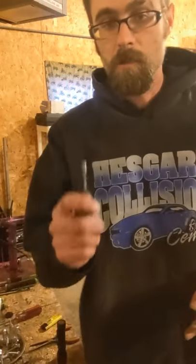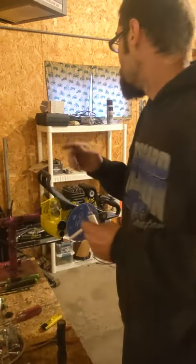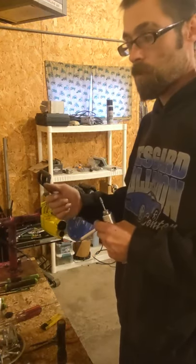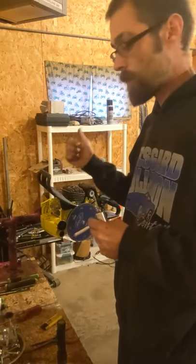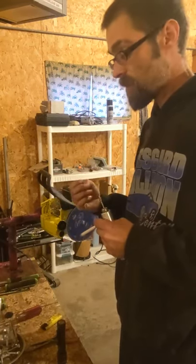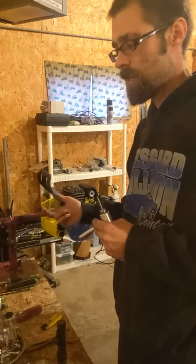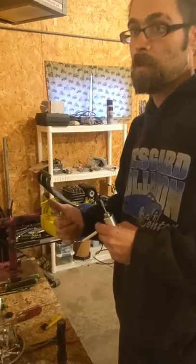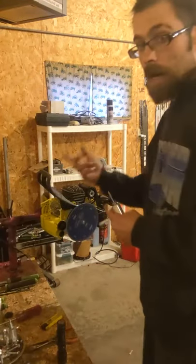All of our exhaust and lower work is done with an aluminum hog bit in a straight grinder. Then we bevel all the edges with an air grinder and diamond bit, use sandpaper rolls down to about 240, then I use jewelry polish with a buffing disc to polish the exhaust back up. The reason I polish it: it prevents carbon from sticking in there for less build-up. It also just looks cleaner and more professional — that's why I polish them up.